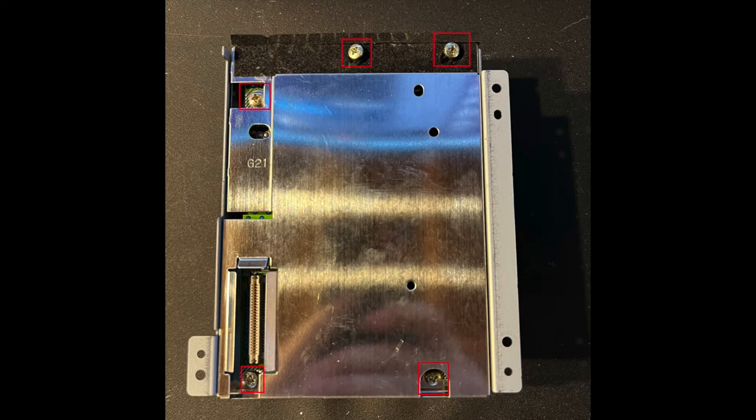Take out your GD-ROM drive and flip it over. You'll notice that there are five screws that hold the whole thing together. The top two screws are hidden by a piece of foam — use a small knife to cut slits in the foam to expose those screws, then remove all five with a Phillips screwdriver. Once you've done that, you can lift the casing pieces apart. Inside you'll find a little computer board. There are no more screws — start to lift that board out. The board has a ribbon cable connecting the GD-ROM to the computer board; disconnect it from the back of the GD-ROM drive but leave it attached to the board. There are also two wires that go into the computer board — remove those as well.